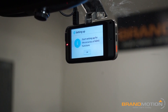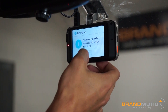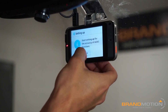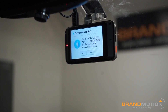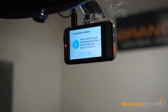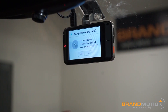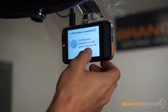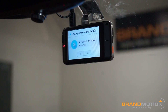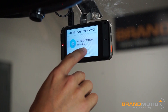The ADAS is powered up. We went through the boot screen — it can take a little bit of time on the first go. We're going to walk through it real quick. Hit okay. It says press yes for the vehicle wire connection, press no for the cigar jack. We used the vehicle connection, so we're going to hit yes. Here it's going to ask me to oscillate power — it's checking for ignition. I'm going to turn my ignition off, then turn ACC back on, then turn that off, and hit okay.